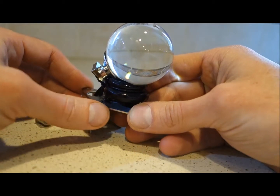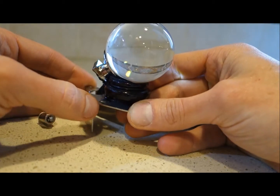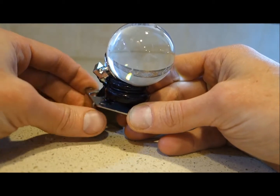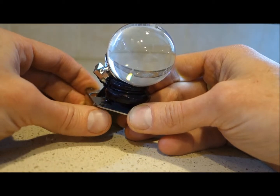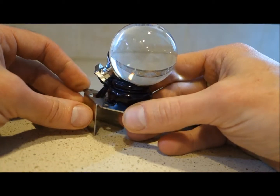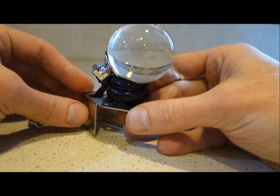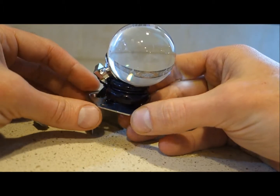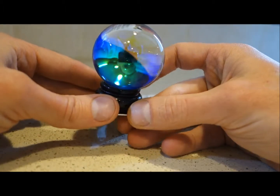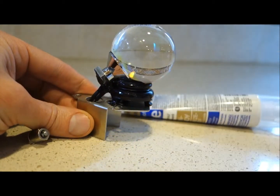He suggested where this screw post is on the machine. When you mount the Palantir, there's a screw that comes up from the playfield here. You can add some washers right underneath the metal bracket there, and there's another screw post back here, and what that does is it just forces the Palantir up a little bit, and you can use that to adjust the angle of the eye without trying to do anything permanent to the Palantir that might damage it.